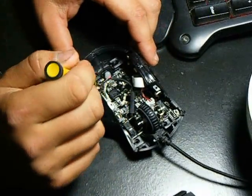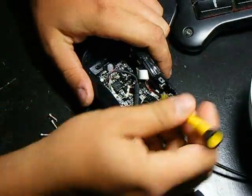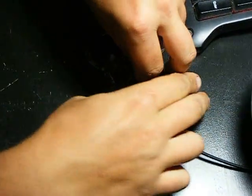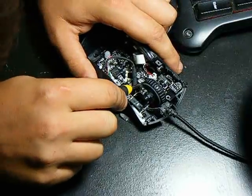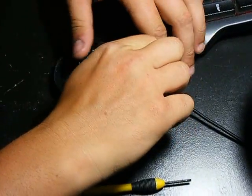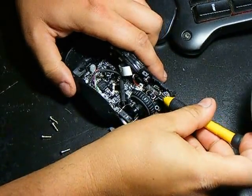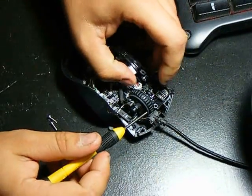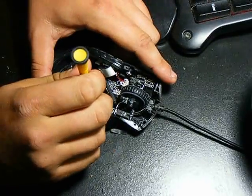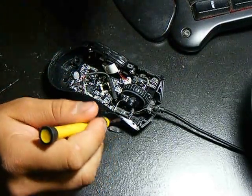And the other thing I like to do is clean the contacts on the circuit board. A good way to do that is to just pry up on the switch. I don't have a pair of pliers to do this, so you try to be as careful as possible. You don't want to bend any pins or break any wires. Just kind of pry around the edge slowly coming up and then gently pull on the wire. Looks like it's just not going to come — forget it. I don't want to damage anything. I can't find my CPU pliers. Use your flat head screwdriver. Try to avoid touching the circuit board — oil in your hands is not good for stuff like this.